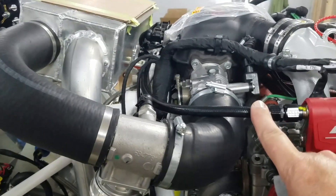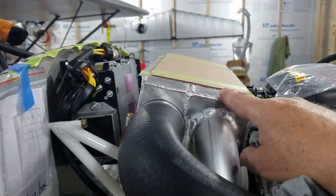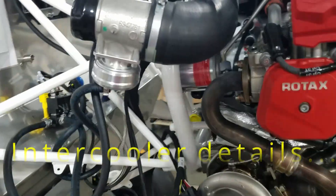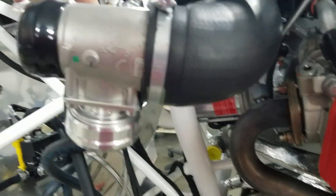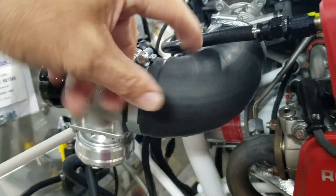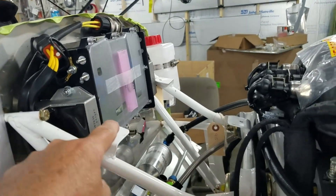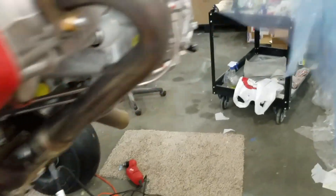We've made a lot of these lines here. These are fuel lines that run up to the injector system here, runs across. We have the intercooler mounted, plumbed up from the turbo up. Did a little plumbing on this overboost valve for your turbo. This is in the way of your intercooler that's set up here, so you have to take this off and cut an inch and an eighth off of this end, then turn it around and put it back on for this application. I've got the hose drilled for my intercooler, already been mounted, and I'm about ready to put it back on there for good after I work the holes over.